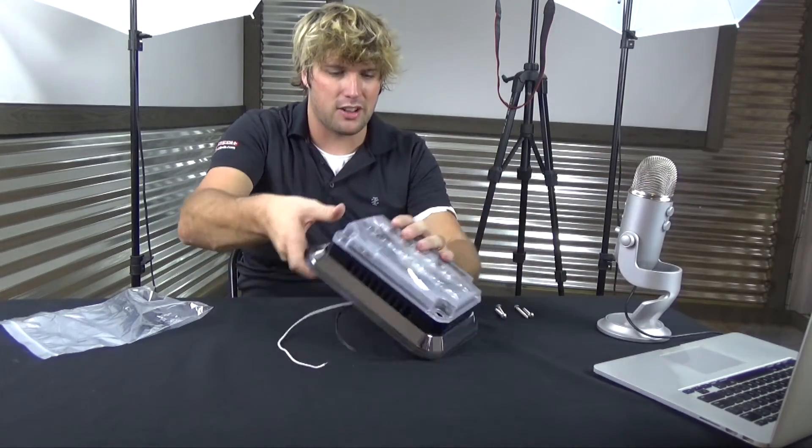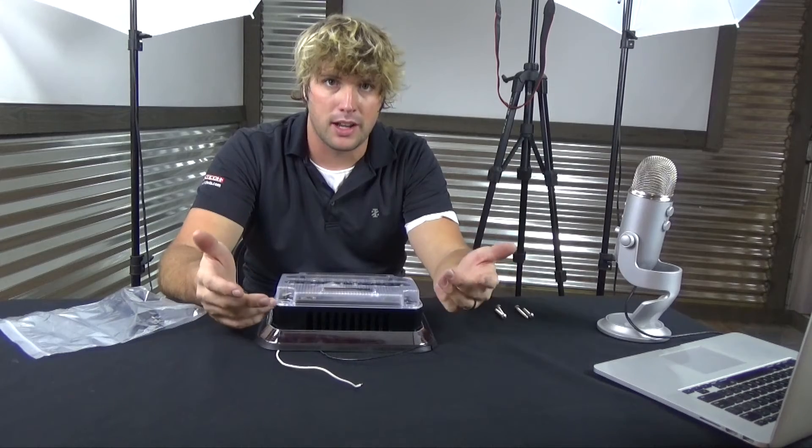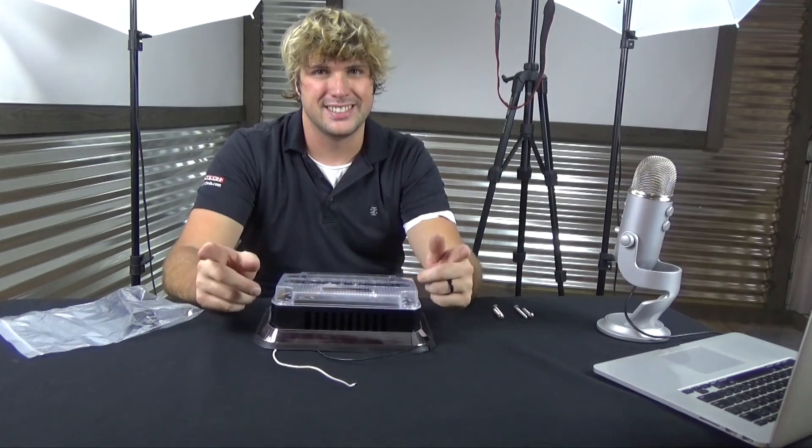This is the FireTech Guardian fixture and we're super excited about releasing this to the marketplace. If you want to get a copy yourself, we've got demo programs to try them out — we recommend doing six on an ambulance for 30 days. You can do the Guardians or the Guardian Elites. The Guardians typically plug right in at 75 watts, so they don't require much change in the electrical system. The Guardian Elite is 125 watts, so worst case you've got to add a relay and upsize your wiring. Check these out online at guardianscenelight.com — that's a subdomain of hivizleds.com — or go to products and click on Guardian. Have a good day, see ya.